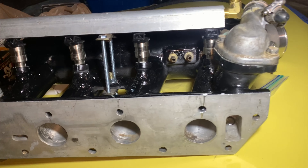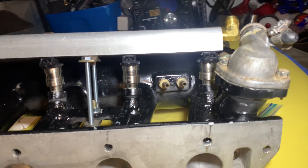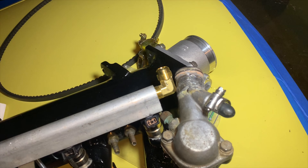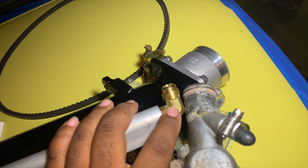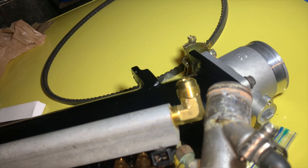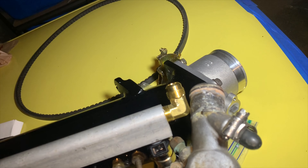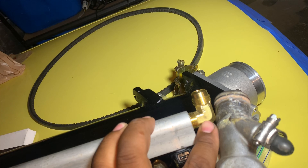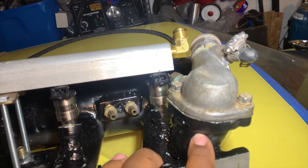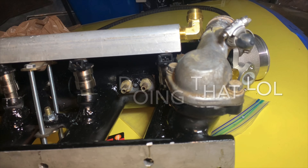More trial and tribulation with the intake manifold. The injectors are in there — hopefully they don't leak once we put some pressure on there. I got the thermostat housing on, and everyone can see the next issue: the original fitting obviously wouldn't fit for the thermostat housing. I'm debating on cutting a little bit of material off just so the hose can slide on and the clamp can go on, or the more extreme option of cutting the whole piece off, turning it slightly, and re-welding it.